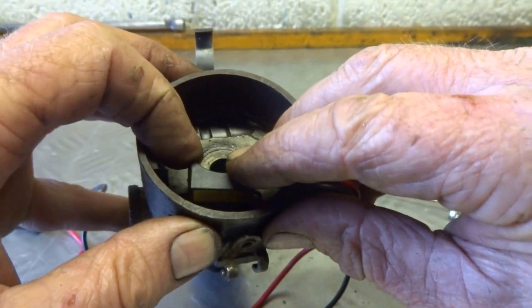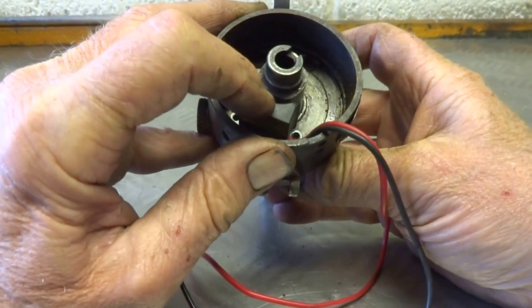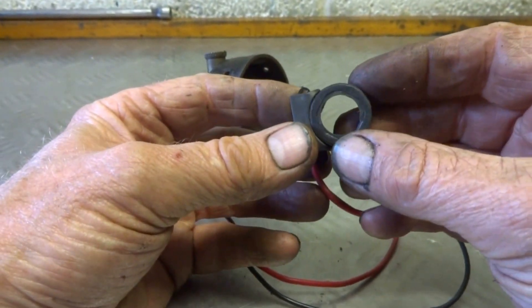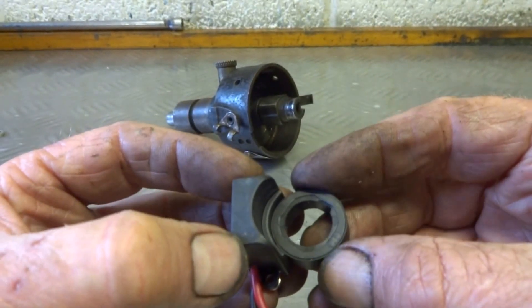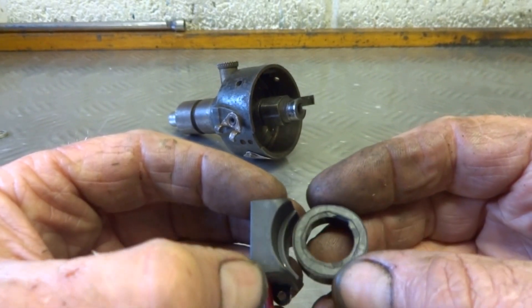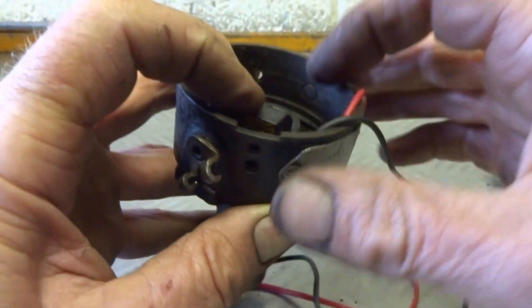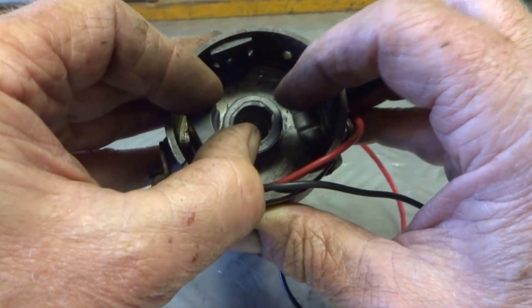Very gently, I drilled a couple of holes in the bottom. You have to make sure you put in the shaft — this is obviously fitted on top, but it's a snug fit right at the bottom. The sensor is actually the very bottom part here, not the top as I thought at first — it's down at the bottom there. So it has to line up like that. The sensor must not touch; it's a bit arbitrary really, but you need about one to two millimetres gap between the sensor and the pickup. So when you're drilling your holes and fitting your doughnut, make sure you have about a one to two millimetre gap. The accuracy is not too bad, but it must not touch.